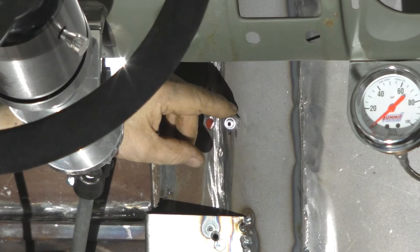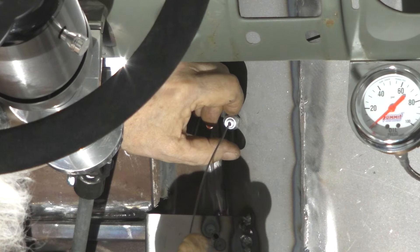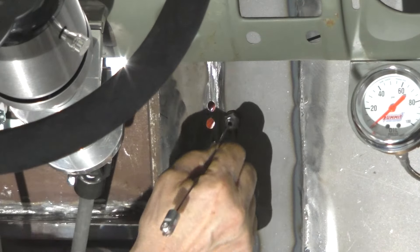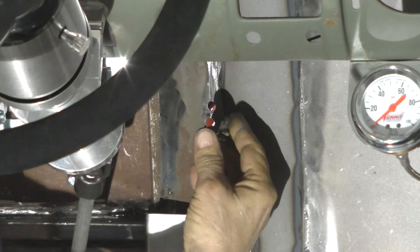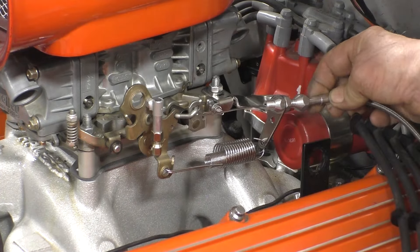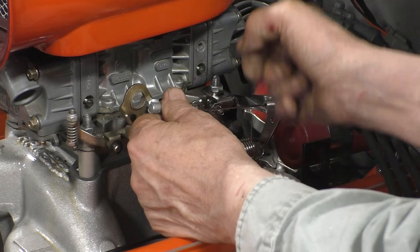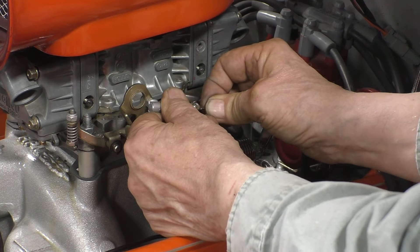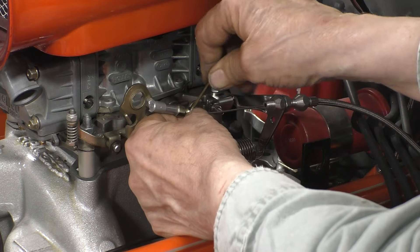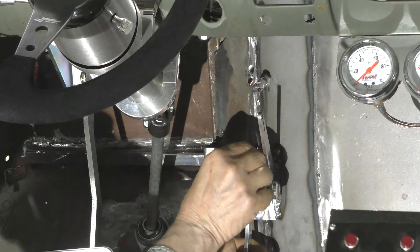With the outer casing of our throttle cable bolted in place and coming directly out of the firewall, we can slide the inner cable into the outer cable and hope that we don't fray the cable on the end. And there we go — slide the sleeve in place. We thread the inner cable into the bracket on the side of the carburetor; it was inset about an inch and I'll put it in the same place to start with. We may have to adjust this, so I'm not going to get that too tight. We'll come back. Next, we'll bolt the pedal back in place.